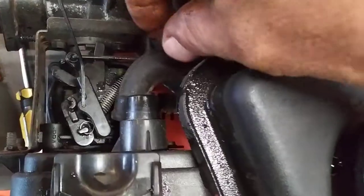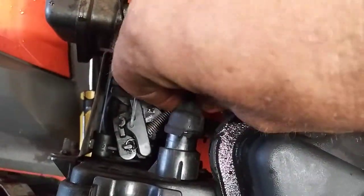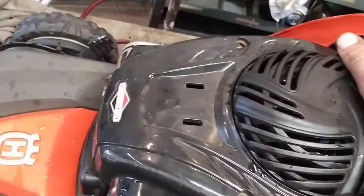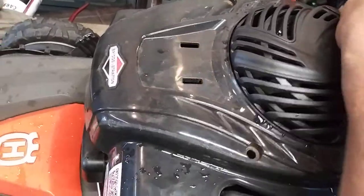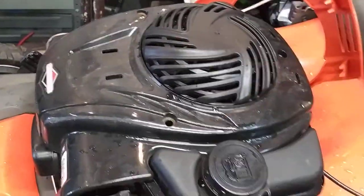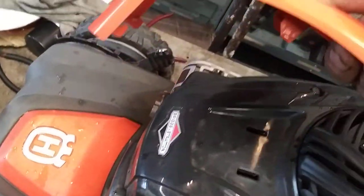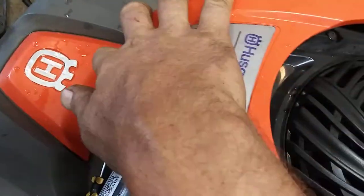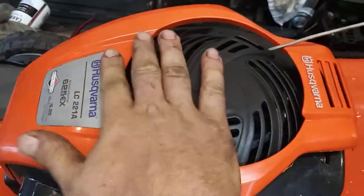There's also this tube in the back — grab it, stabs right on. Put the recoil down in place, get it set in place, and three 8mm bolts on it. I'm going to put this back on — it's got little hooks, so you want to set them down and hook them under this front cover first, and then everything else will click down into place.